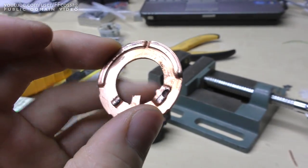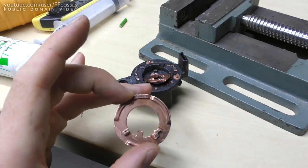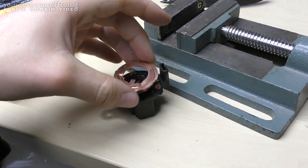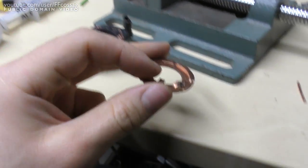As you can see, we've got a huge hole in this connector here. This spins around and connects to these copper studs in the ignition lock — like so, spinning around. This is obviously shot and should be replaced, but the car is not worth having this replaced professionally, so I'm going to fix it myself.